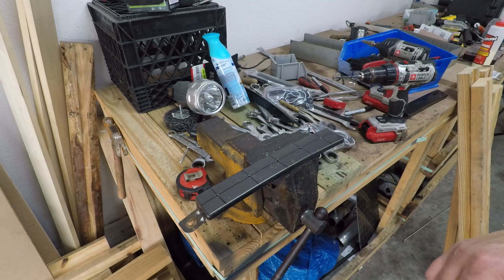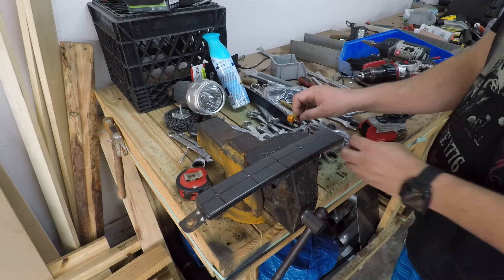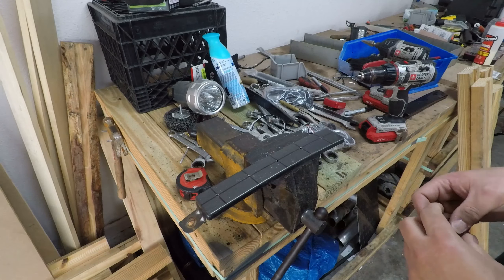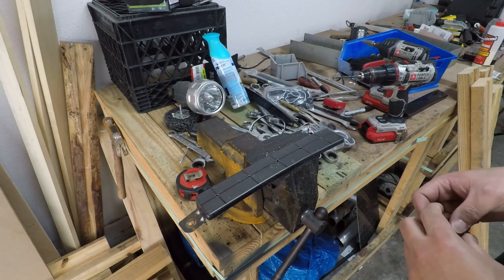Now that we have the pilot hole started, I'm gonna get one of the lights out. These are LED — you don't have to get LED, but if you do, remember you will have to get the LED relay; I'll link that in the description as well. What I need is actually the grommet, so take your grommet and figure out what size is going to fit best. Mine goes up to 5/8 but the light is 3/4 — you can see the outside of the light is 3/4 — so I'm gonna move this over just a tad.